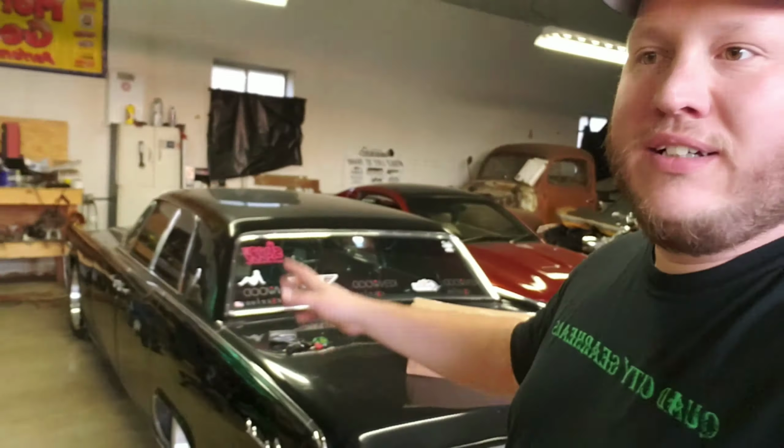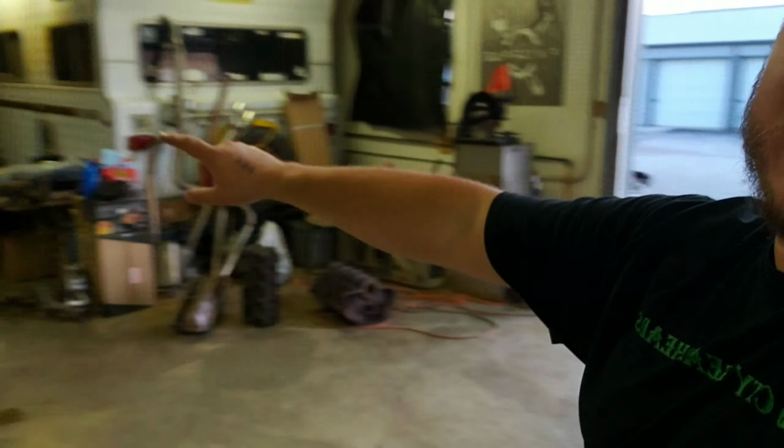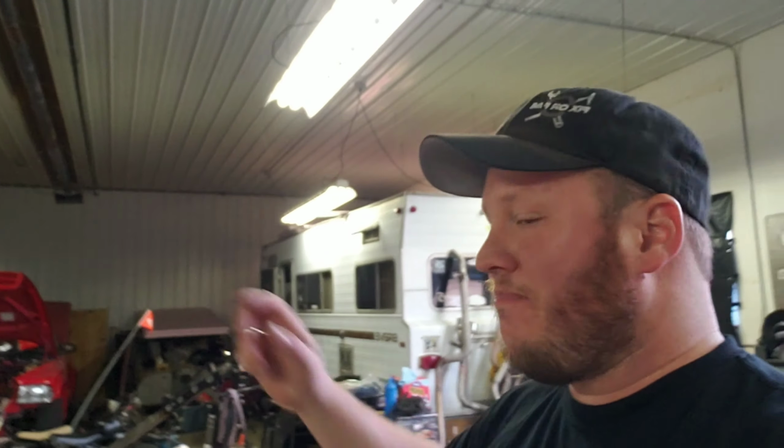We fixed the Lincoln. I didn't film that. But today, we gotta get this motor that came out of my RT. Remember, we blew that up. Well, not blew it up. We dropped number one cylinder, because it was only at 60 pounds. The rest were like 150, 160. I got pictures. I'll see if I can post them in here.